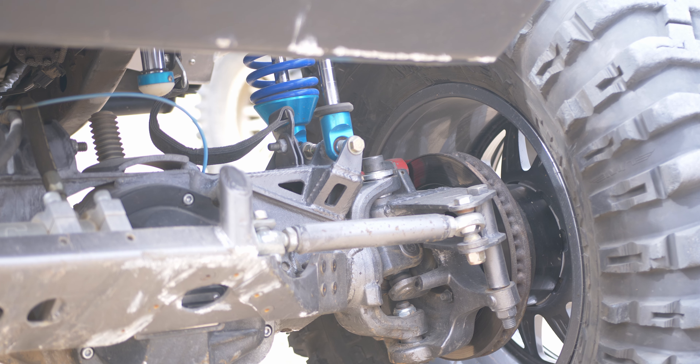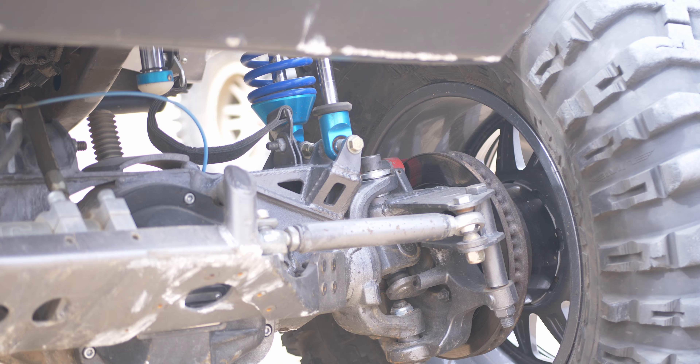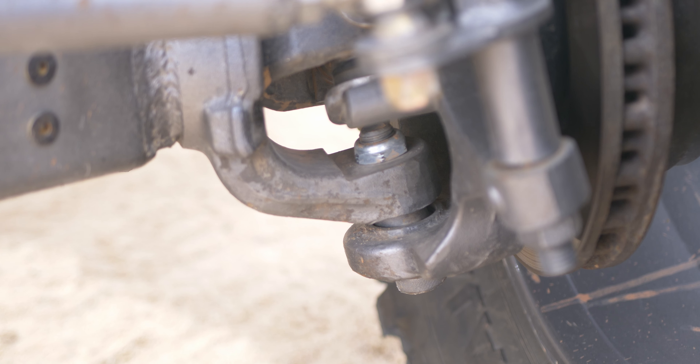What I have on the Reaper is American Iron's ball joint delete system, and it is one of those unsung heroes — something that's so easy to overlook. People ask what axles you're running, but just because you've got a Dana 60 on there doesn't mean it's necessarily strong. Those things have weak points, and one of the weakest points on the Dana 60 is the ball joints, especially the upper ball joints.